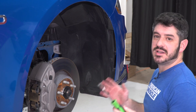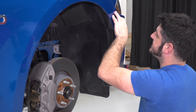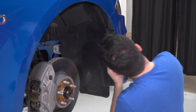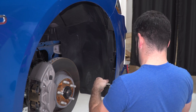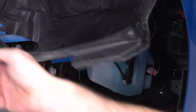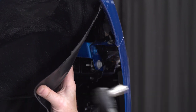I pulled the front wheels off of the vehicle just to give you guys a better view of what I'm doing inside the inner fender liner. I need to remove the clips for the inner fender liner and pull it back out of the way, and that's gonna reveal some 10-millimeter nuts at the inside corner of the bumper that I'll have to remove. I'm gonna use my clip tool to pull these clips out of the way and fold back my inner fender liner to get to those nuts, then repeat the same process on the other side.